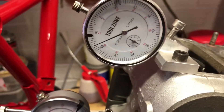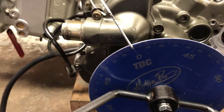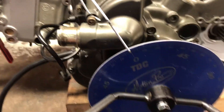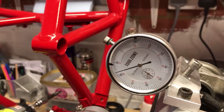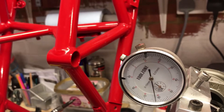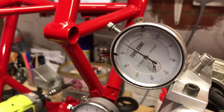What I'll do is I'm going to check the timing of our inlet cam. Because I've set this to top dead center already, I'm already into part of the stroke for the inlet cam, so I'm going to back it all off and then redo that movement. So let me just spin that around. Right, so here we go, it's coming up to open the cam.